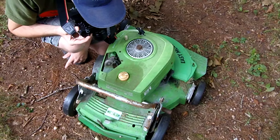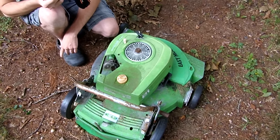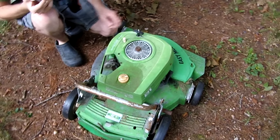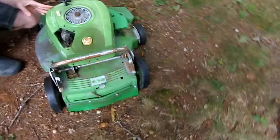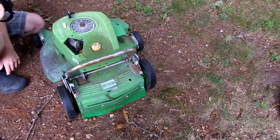You see the problem with this is that this pulley, which should be spinning like that — the bearing went bad and you can actually see how it's not centered anymore. It went to the side and it carved into this bracket, and that was the end of that. These pulleys are absurdly expensive, which is why it's just been resigned to be a push mower at this point.